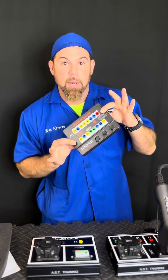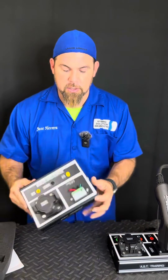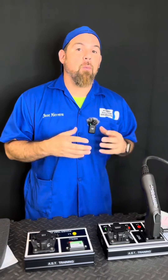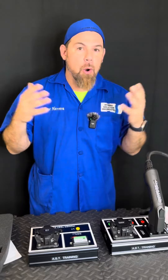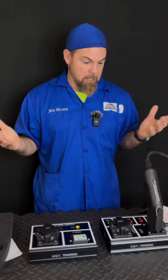The EV Circuit Detective is something like a breakout box for the OBD2, but this is a breakout box for the high voltage cables that you connect from the grid charger to electric and plug-in hybrids. If you want to diagnose an electric vehicle's onboard charger, the only way to access the high voltage line, the proximity sensor, and the communication line between the onboard charger and the grid charger is to open those units — and that's a lot of work, even hours of labor, depending on the type of electric vehicle.